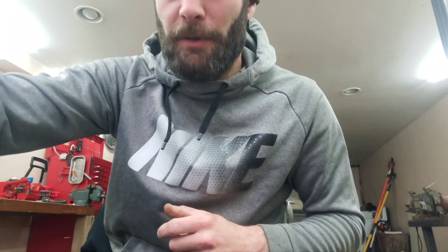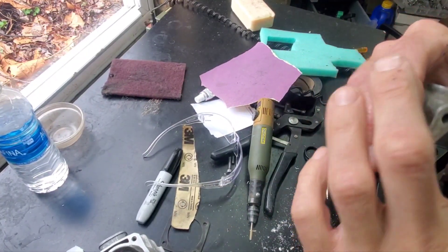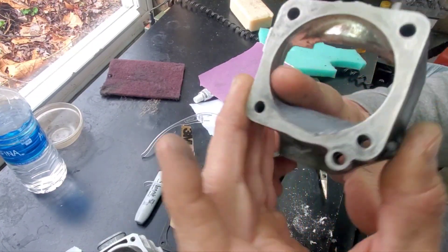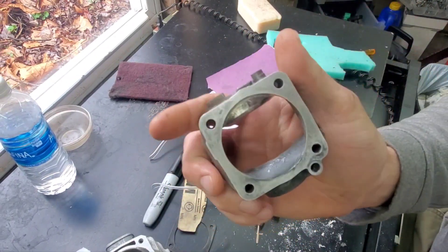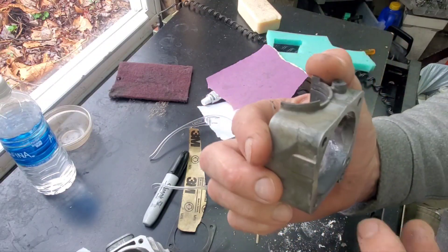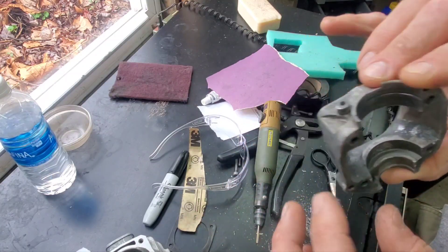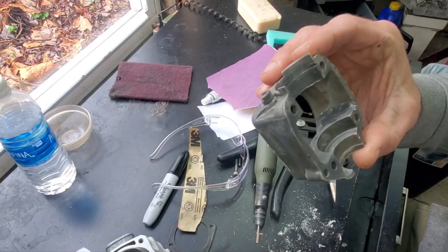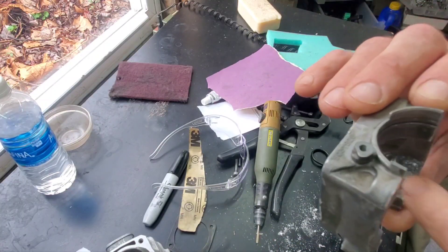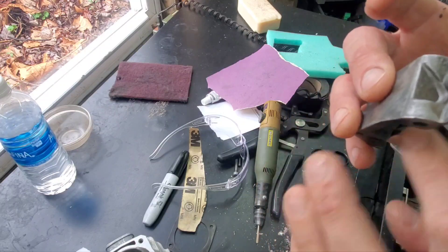I'm going to be in and out of the shop all day, so I'll just save this and pop in later. Alright, here's what I ended up with after a while. I had taped it and filled it and it was nice and level, then I came to check on it a few hours later and it was like putty. So I just molded it - molded it down where I wanted it, taking up a little bit of that case volume to keep our crankcase compression high.